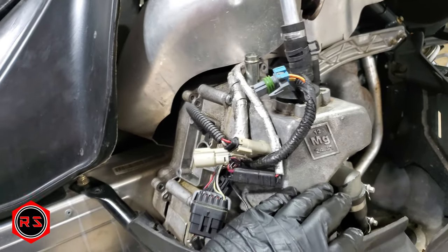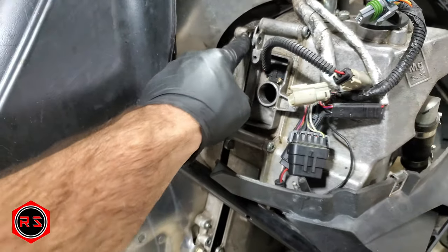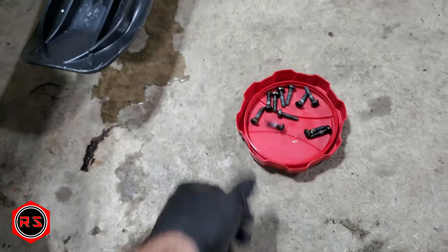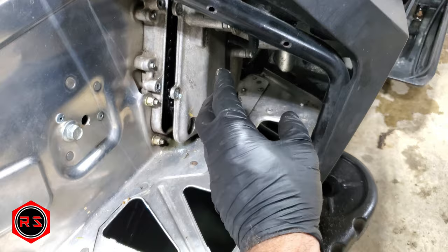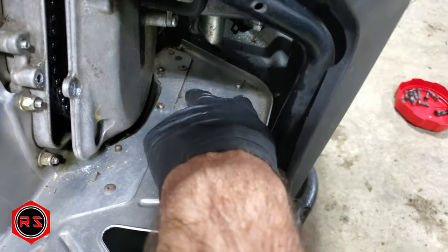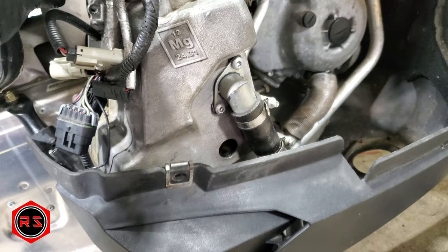Since it's a four-stroke I don't want to touch the oil tank. My goal is to split open the chain case which is here. I need to remove these bolts — there's a total of 11 bolts, Torx T30. They're pretty much all easy to remove, but you will have to remove the foot peg or foot rest here, which has two bolts there and two at the bottom under the skid. It's also easier to remove the screw here so you can move the plastic and pull on all this.